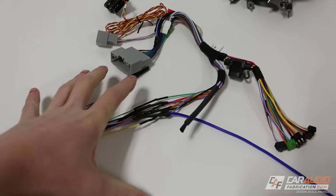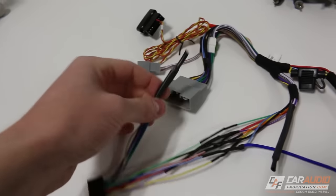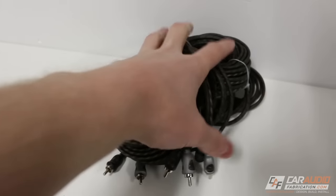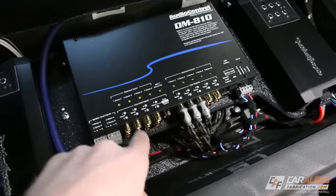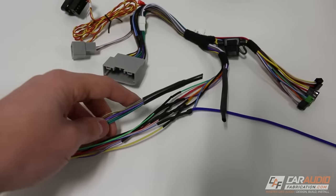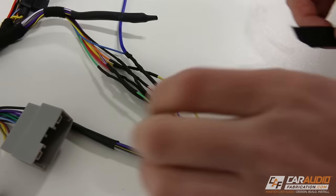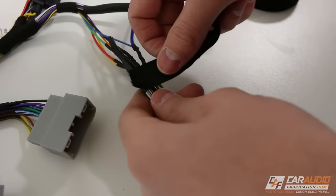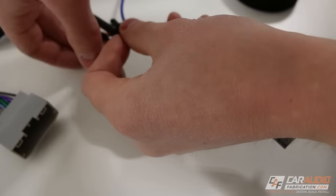The harness is now complete. A couple of things to point out for my particular installation: all the speaker wires from the new head unit — I'm not actually going to be connecting those to the harness. The reason is I'm going to be using RCA outputs on the new radio to send the signal to my aftermarket amplifiers, routing the audio signal into an AudioControl DSP via the RCAs. I'm no longer using the speaker level connections, so there's no sense in connecting those cables. I've covered those unused wires with heat shrink.